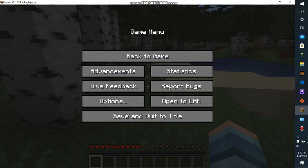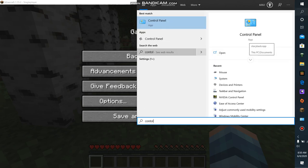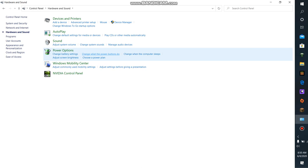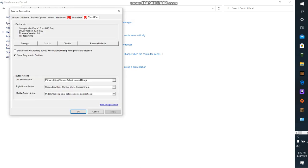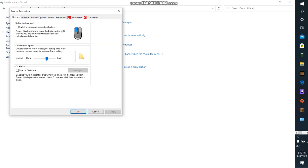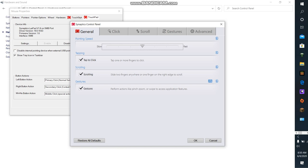Let's press Escape and go to Control Panel. I already have it up but I'm just doing this to show you guys. Press Open, then press Hardware and Sound. Under Hardware and Sound there's a link under Device and Printers which is Mouse — click on Mouse. It's already on the Touchpad tab but there are several tabs here, so go all the way to the Touchpad tab.